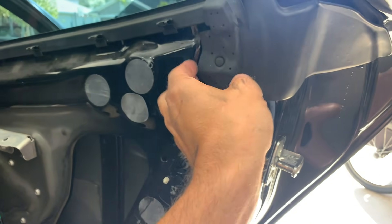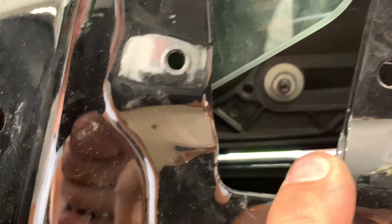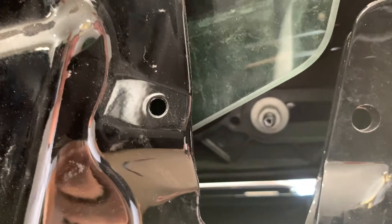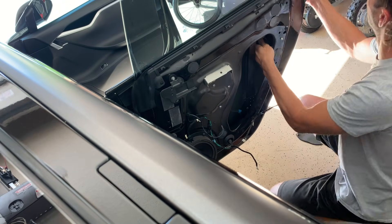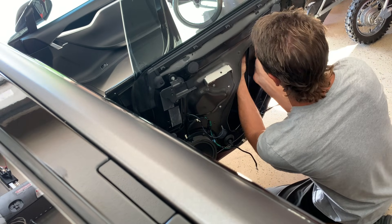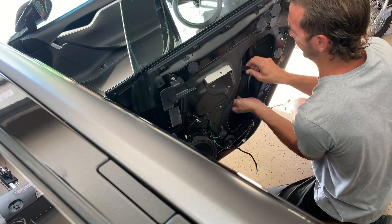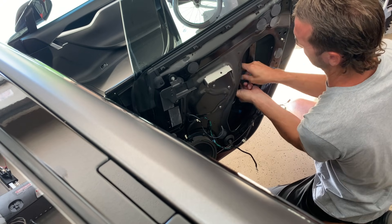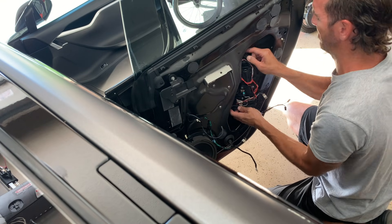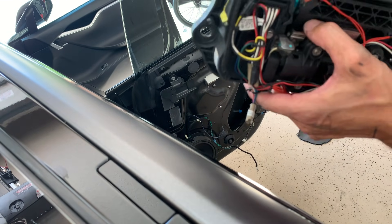Now you can see there's just one nut right there at the top. This will allow you access to the other one, and then the other two nuts are kind of hidden. Here's the other nut that holds the door handle on — remove that one, the one I just showed you, and then the two hidden ones. Once you have those removed, you'll need to maneuver the handle around. I had it upside down, then just rotated it inside the door until I finally figured out the best way to remove it. Once you've got it out, pull it all the way out. As you can see here, this is the broken paddle gear — it's not moving with the handle.